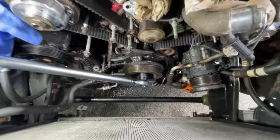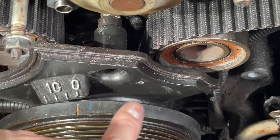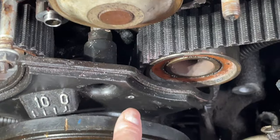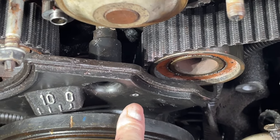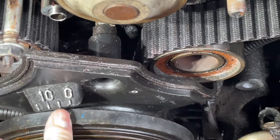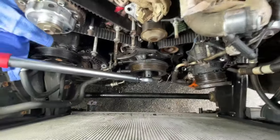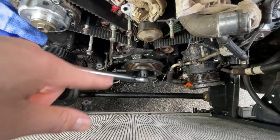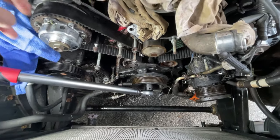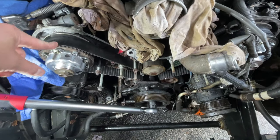And a little pro tip here, we'll advance that hash mark. Used to be a little stubby thing here, but I broke it. You're going to advance this hash mark to the little stubby thing here. That way, when you put the new belt in, because it's spring loaded, it'll spring back to the zero top dead center. Then you can remove the harmonic balancer pulley. So don't remove the pulley, don't remove the tensioner until all of these are zeroed out or calibrated. That way your timing is accurate,